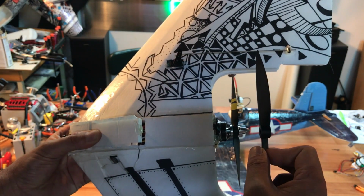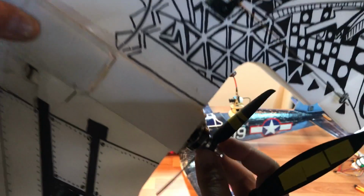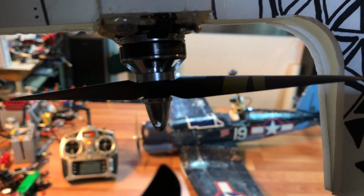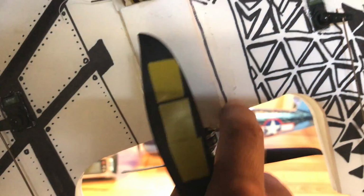You don't turn the prop around or anything like that. It's still letters and numbers of the prop still go forward. Let's see if we can see the numbers on the edge of this. You can see that the numbers here and the letters are facing towards the front of the airplane. So it's right here, and here's the front of the airplane.